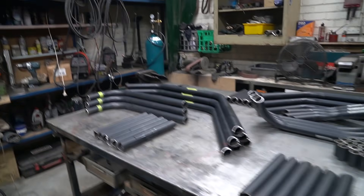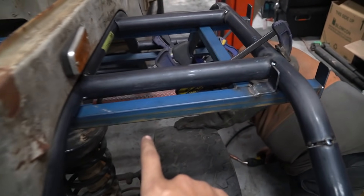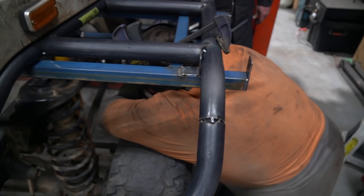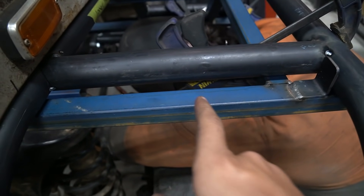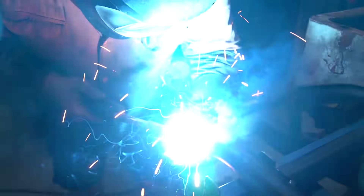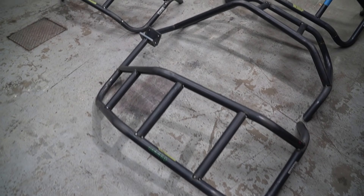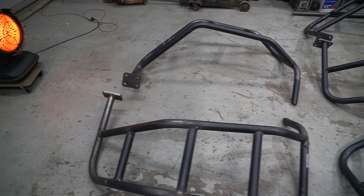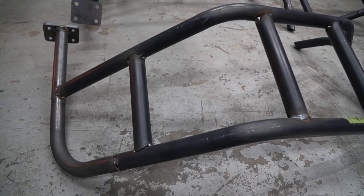Three sets of guards on the go, there's a bit of bending here. We've got a jig which comes out the side of the car which the guard sits on to get them all straight and parallel, so it's pretty hard to build them accurately without the jig. There's a lot of extra work to get them in the right spot. Got three sets here and these are my sets — I've got to take them home and fit them up to the car now.